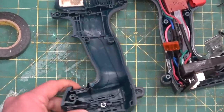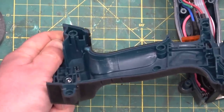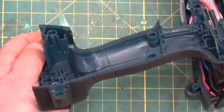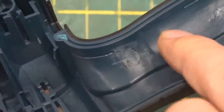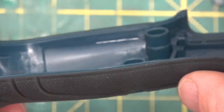Well, let's look at the state of the mold making here in Malaysia. Not generally, you get what you pay for, but you would think that this being a high-end professional tool, you'd get some pretty good mold makers in there, but patch jobs all around, hand polished and not very well. And then you could see this part wasn't sticking in the proper side of the mold in order to rotate it around and get this overmolding on here. So they've had to add a little artifact to help hold this in the mold better.